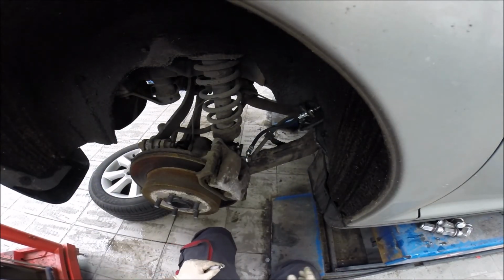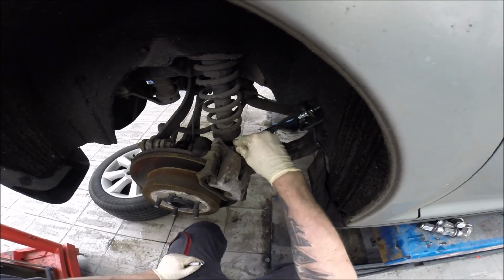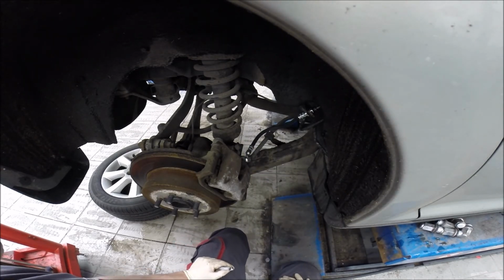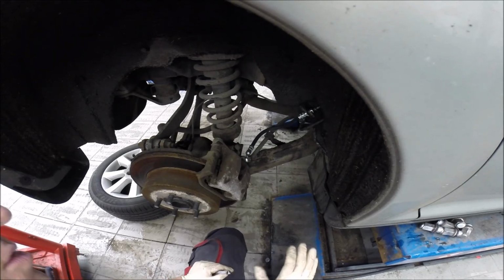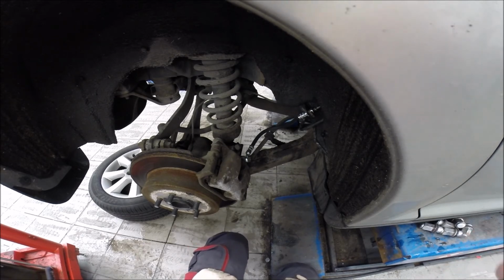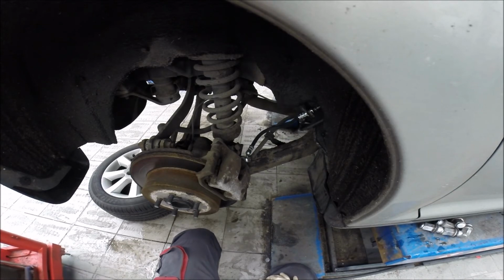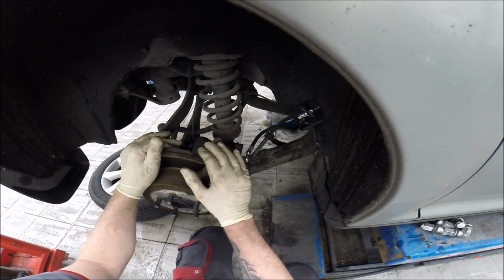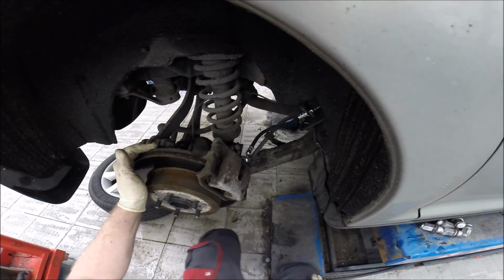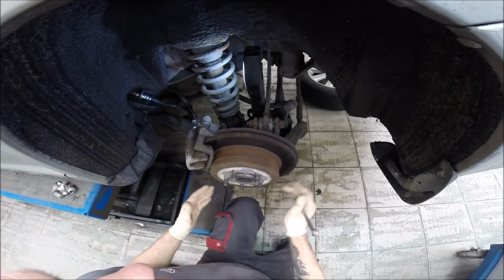After pumping the brake pedal, don't forget to check the connection. 100% no leak, or the best idea is to go for a quick spin. Use the ABS, that means hard brakes. Come back to your place and double check for any leak from the system. And exactly, job done. Yeah, on the other side we adjust the handbrake and that's all. Put the wheel on, test drive. So like I say, we have to check the brakes.